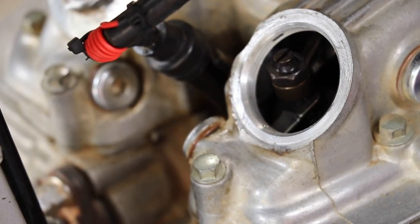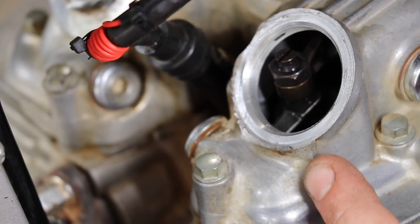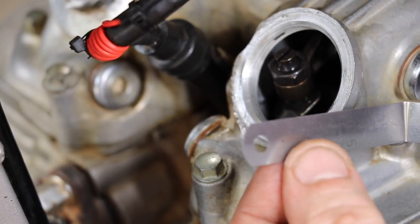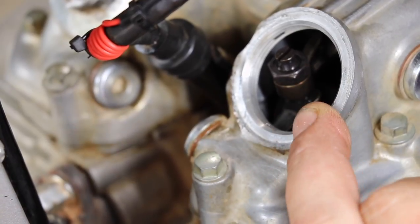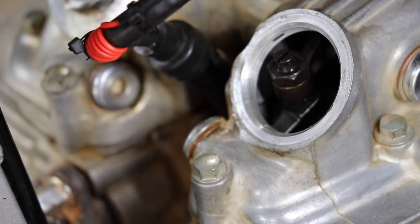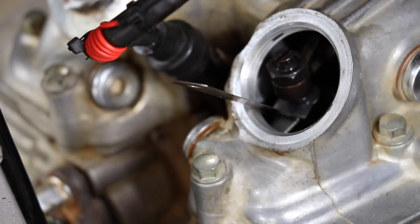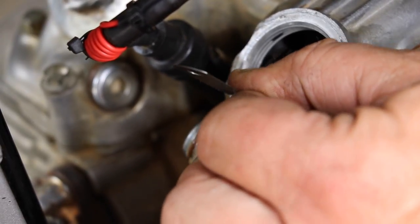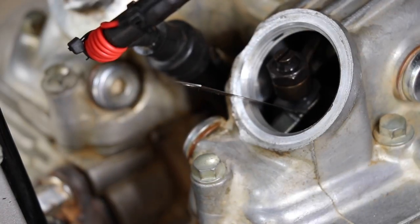This particular procedure is going to be more specific to bikes with adjustable valves. Now we're going to take our feeler gauge and actually check the valve clearance. This particular bike takes .005 inch on the exhaust side. What we'll do is slide the feeler in between the bottom of the screw and the valve stem — we should have a little bit of drag, but it should not stop it. And these are actually perfect.